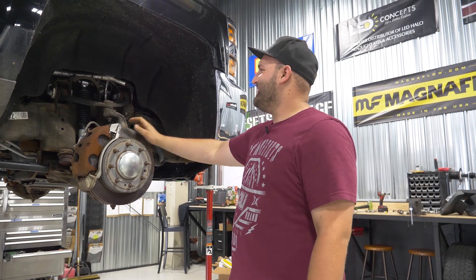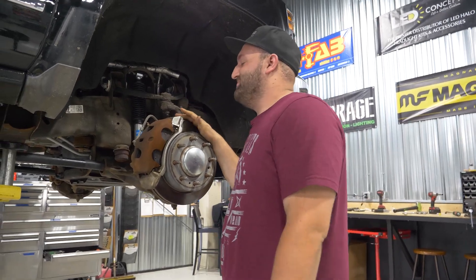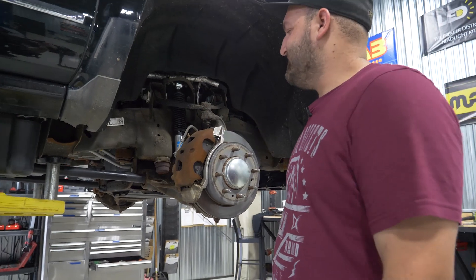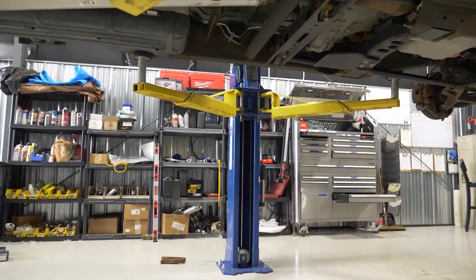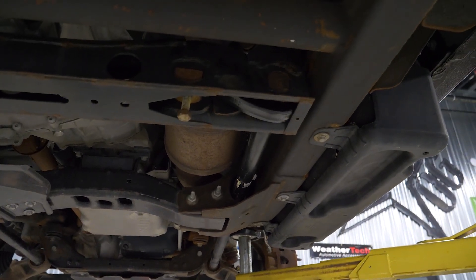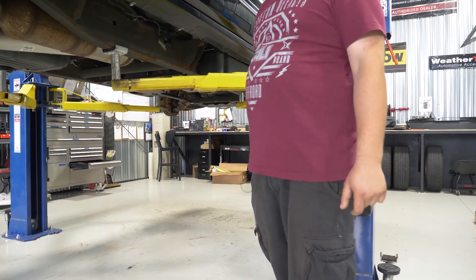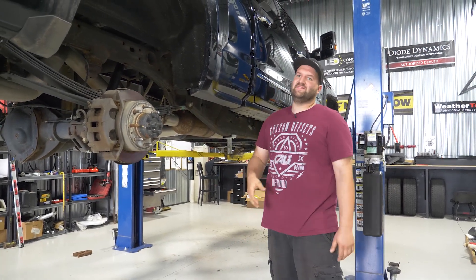So this is the Kryptonite Stage 1 leveling kit that we mentioned earlier. There's really not much to look at here — you pretty much remove and replace the factory front shocks with the new Bilstein 5100s that this particular kit comes with. No spacers are used on this kit. The new leveling keys are in place, which you can't see here — we'll have to have Boston go under there and film them. There's no real specific way to set leveling keys. We usually turn them in about eight to ten turns once they contact, put it on the ground, see how it sits, and then adjust from there.